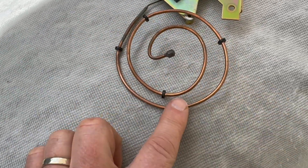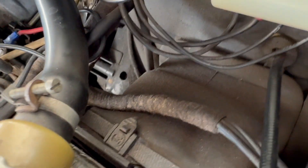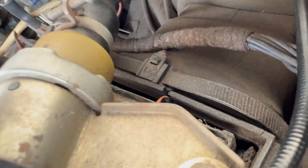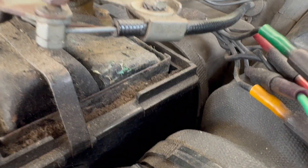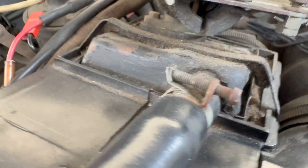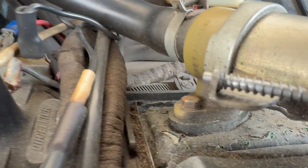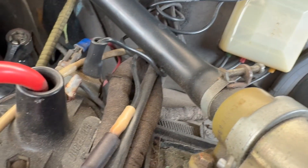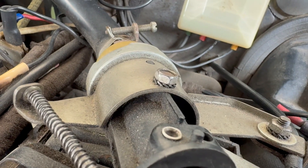I think this goes in the hot airflow. I'll show you where it is on the car. You can make out that wire which then sort of disappears down there - I think that must just go into the vents, but I'll have a look when I pull it out. It's just a case of disconnecting the controls, two M8 nuts to hold it, and then just undoing that pipe. I've got some towels to put around it, so let's see how we go.